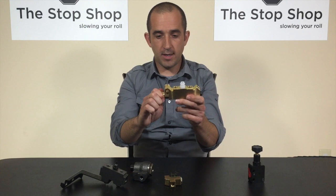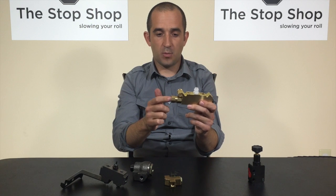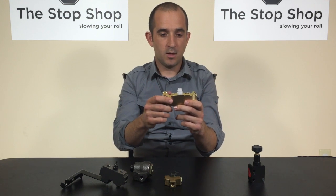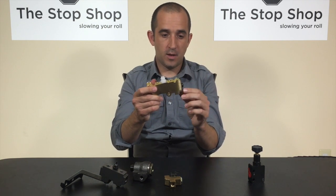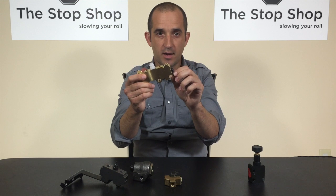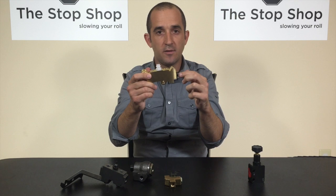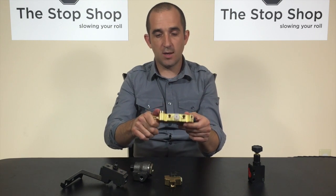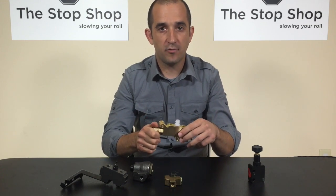This rear port right here on this particular valve — a 71 through 77 valve for GM cars — is the proportioning function, built right into this rear port to feed the rear brakes. It acts as a distribution block that routes everything throughout your car, and this little rubber cap you see in a lot of valves is covering up the metering function that's actually screwed into the front of the valve. So these three valves, starting in 71 on GM and 73 on Mopar, are all combined into what we call a combination valve.